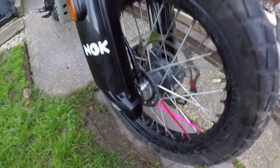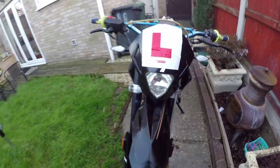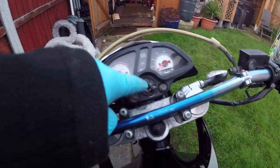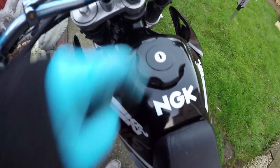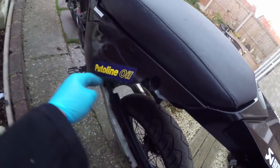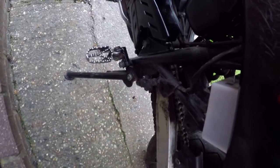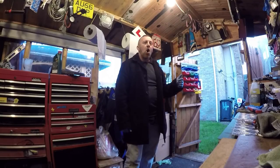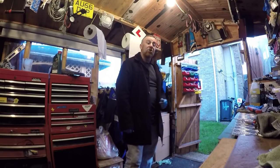There's the speedo drive — that's sorted. Yet to do the brake lever. Slightly skewed but only held on by four little bands basically. I've always liked that they have a gear indicator — it's really, really handy. These switches again — WD-40 regularly, they really do mess around. Put some WD in here. A few extra decals on it, doesn't look too bad. The finish is never going to be great because it's got a little cracked bit on it, but hey. All I've got to do now is adjust this — it's very, very stiff — and give it a really good wash and clean. I'm going to continue and clean this now even though it's cold. It's getting looking nice. Just a brake lever and a stress plate to sort out, and that is job done.